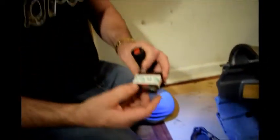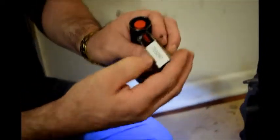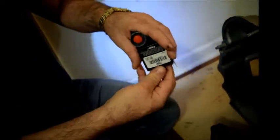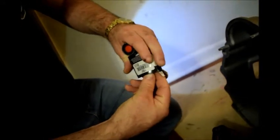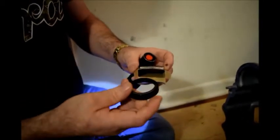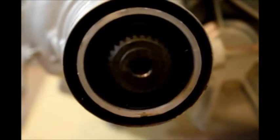The four-wheel drive uses a much smaller bearing and I had to hunt this down doing a lot of cross-referencing. It's a 710247 — that's the original seal to replace the tail shaft seal. Now the original seal was made by Honda and put in this Isuzu transmission, because the number I pulled off the original tail seal was an expired Honda number. Note that it's a relatively small seal that goes inside the tail shaft, for the rear tail on the four-wheel drive — at least for this MUA 5 five-speed.